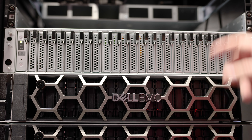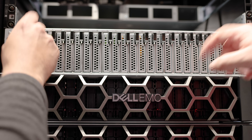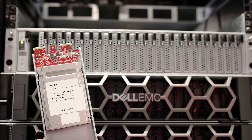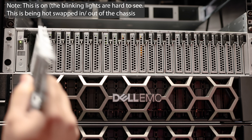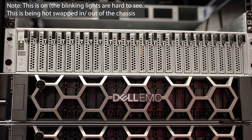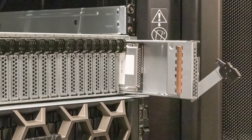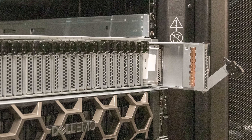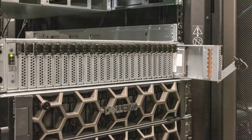When you look at the system and pull one of the drive trays out, what you're going to see is that there's an EM6 drive in there, and this funky little red board — we're going to get into exactly what's going on here in a moment. The big thing is that this is serviceable like a normal NVMe or U.2 SSD. These are hot-swappable. The next question is what makes this system different, and why do we even care about this whole EM6 thing?